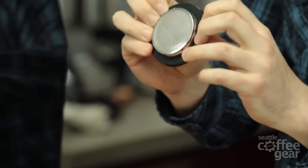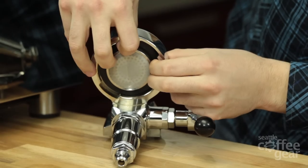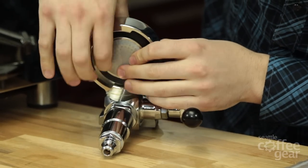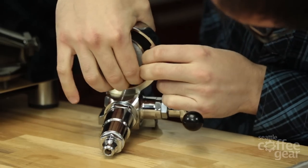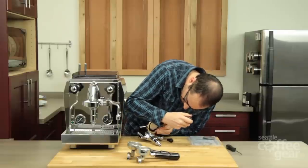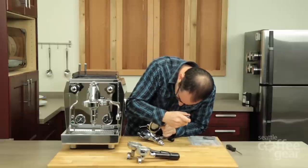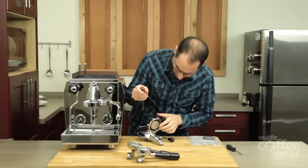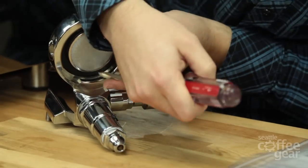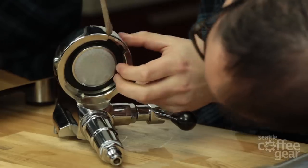It's important that as you're putting the gasket and screen in, you're not just pushing one side — you want to slowly push from all sides to prevent it from buckling. You'll notice the gasket will gradually go up into that groove. Use your flathead screwdriver to really start forcing the gasket into that groove, going all the way around slowly. Eventually, the best way to fully seat the gasket is by actually using your portafilter — that will push everything up evenly at the same time. Let's take another good look; we're almost all the way in before we really test it with the portafilter.